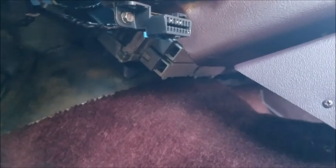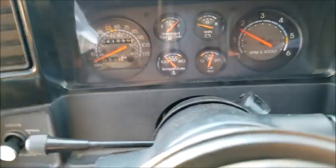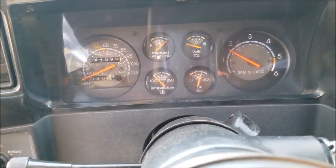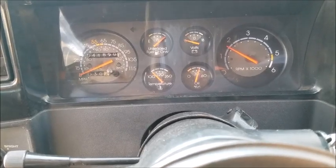The computer is right here behind the dash. Wiring goes through the tunnel and that's the OBD2 port - mounts in the factory location where the original OBD0 would have been. The gauges work; I converted the speedometer to electronic but everything works. The speedo goes through the PCM so it can get the right signal.